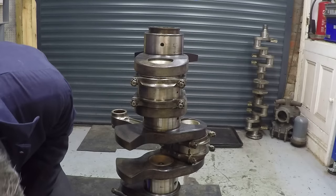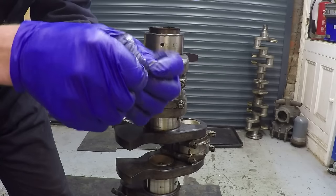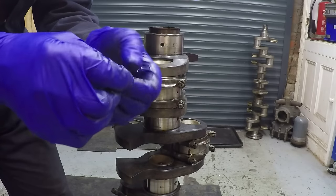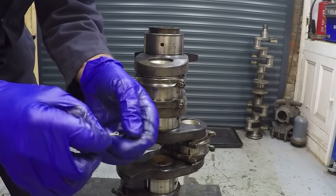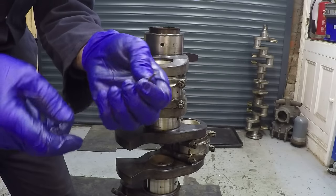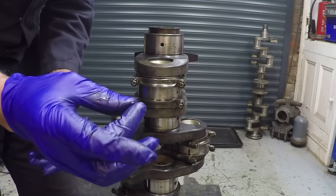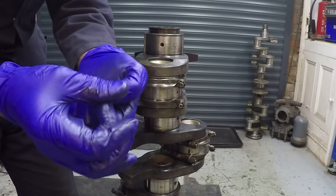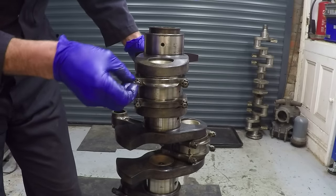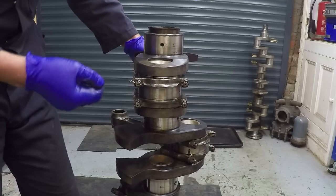The split pins, to be honest, look like every other regular split pin. They've got corrosion inhibitor on them - they're stainless steel in actual fact - but they were ground. They're ground because you can't hold the ends of these things. Anybody that does machining - they're actually ground between a set of grinding stones, rotating as they pass out to the end of the grinding wheels. They're quite a close fit in there.